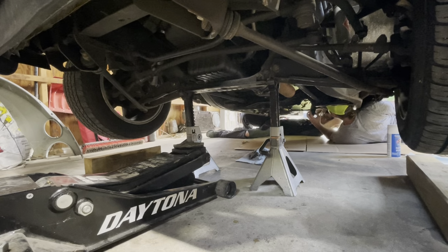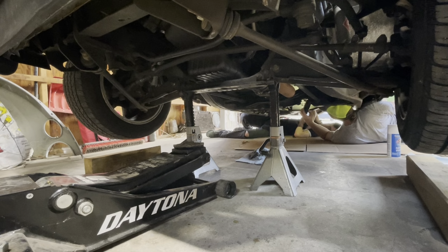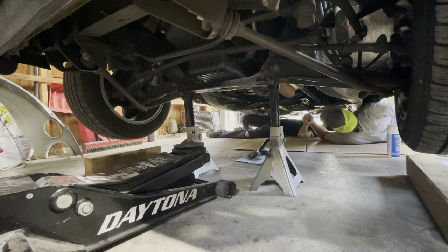That's actually impressive. There are washers underneath the carrier bearing mount, which means somebody has raised it up. That's good, because when you lower these trucks, it changes your angle, and to help correct that, you space it out. So that's actually kind of cool. Someone's been in here before and at least tried to do a decent job. I mean, it still roached it.